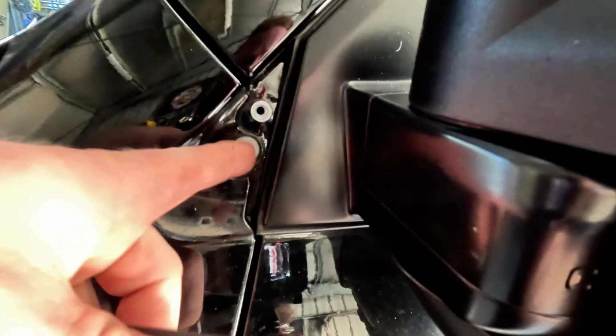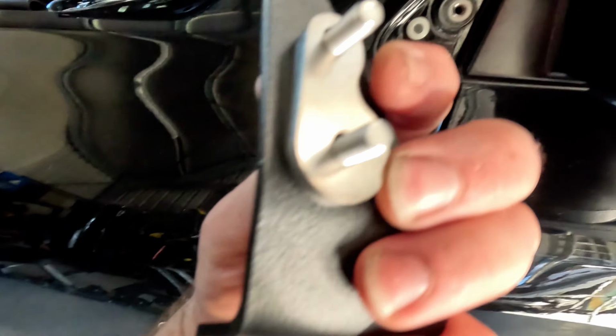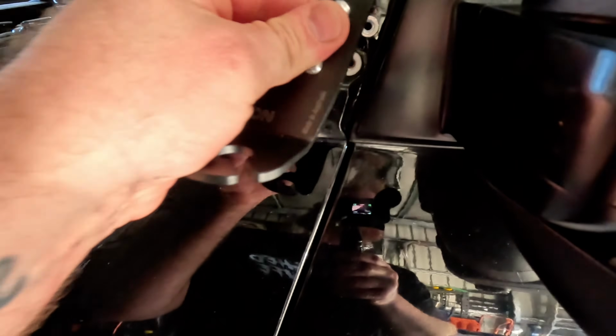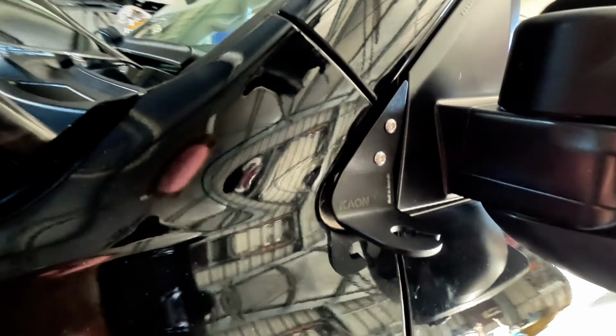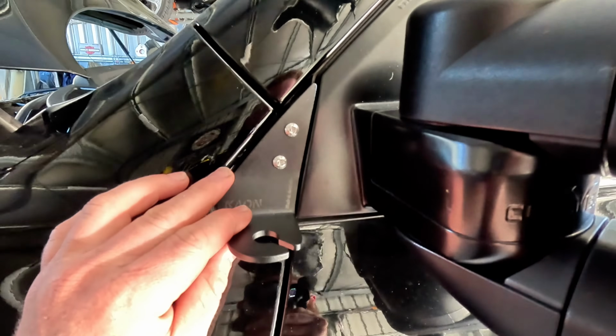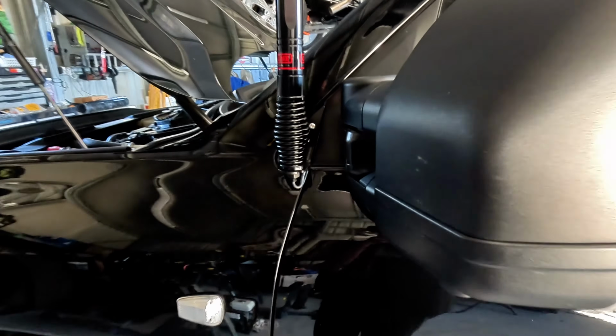All right, the nutsert has been installed and I've removed this bolt. So now I'm going to chuck the bracket on with a couple of spacers on the end here. That should just sit on there neatly. So that's pretty much the idea of it. Go ahead and tighten those up and then start on mounting the actual UHF. Okay, so that's it. That's the mount all set up.